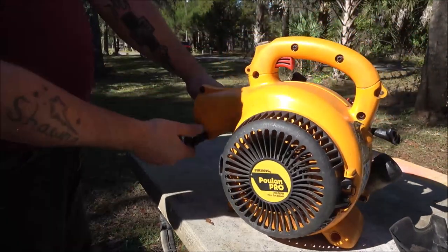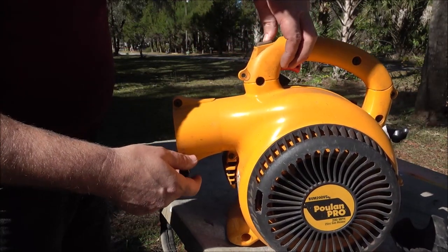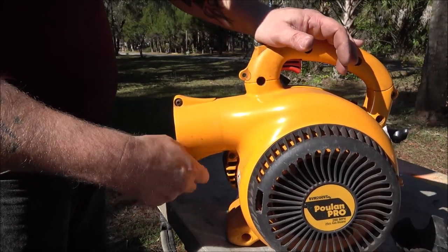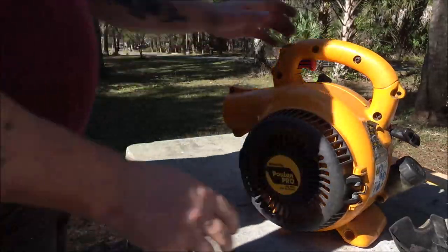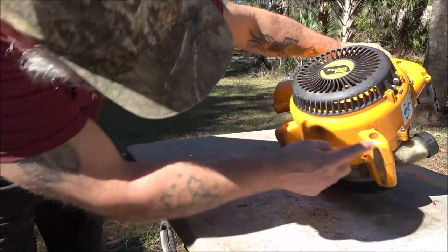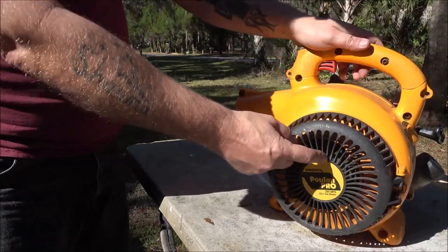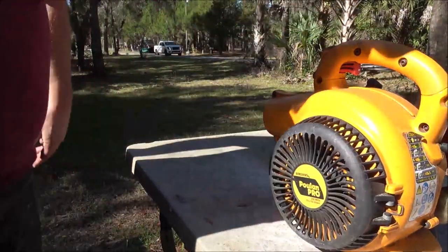And we're gonna check that switch first. It's very rare, but I have seen them stick inside the contacts, but I felt a weak spark and then I felt no spark. So let me go get my tools for this. Looks like they're all the same. A couple way down in here too. And let's get this side cover off of here, that way I can get to that switch and check this recoil. The recoil's on this side, it looks like. I don't know. Let's tear it apart.